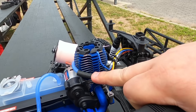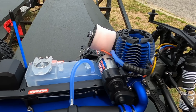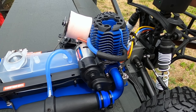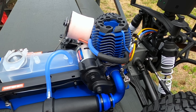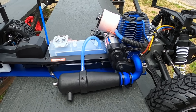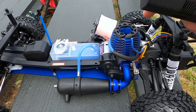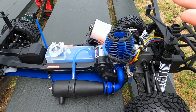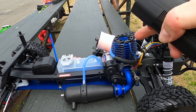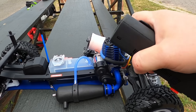The fuel line here is actually really well protected in this heat shrink, but normally we should be able to see fuel in the fuel line. You plug the exhaust — okay, I saw fuel. That's it, you can let go of your finger. You heard how it's priming — it changed the tone. That means the engine has been primed correctly, so it's full of fuel. Now, you don't want to keep priming it more than that — you will flood it. Do you do this every time on a cold engine? Generally on a cold engine, yes.